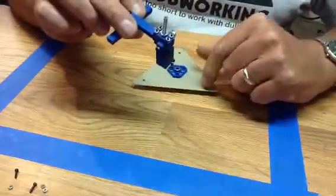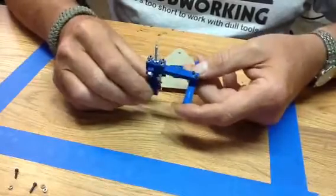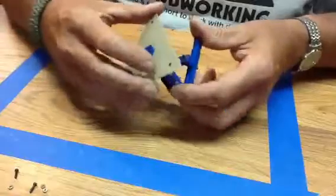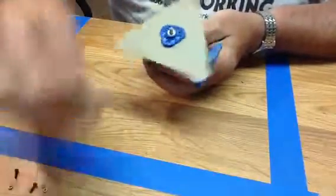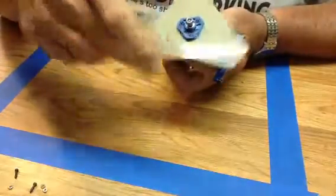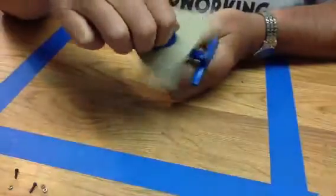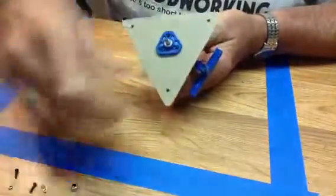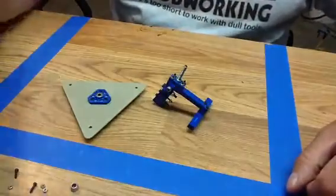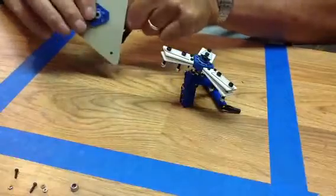Now, you mount this on the mast. This way, this way, it all works fine. After you get it all on, you put this on the stud. Bing, bada bing, bada boom. Put your nylock on. Tighten it down to where there's just a little bit of interference, and then back it off, and you're good to go. You're ready for a maiden. And basically, that's it. But there is a lot of modification to go from this to this.